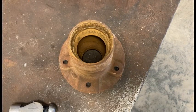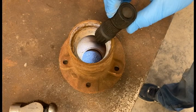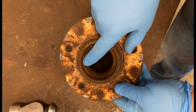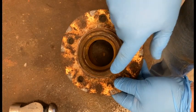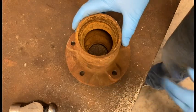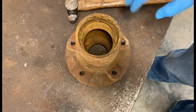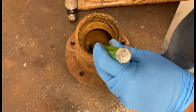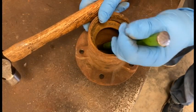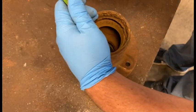So I'm over here at the bench. The next step is we're going to drive out our races. If you can see down in there, there's a little notch in the casting — that is the back side of the race on this front end. We've got about a quarter inch between the lip of the race and the outer edge. I'm going to flip the hub around, put on my safety glasses, and drive that down until it hits the table, then set it up in the vice. There's also a notch on both sides, so I'll work back and forth inside those notches.